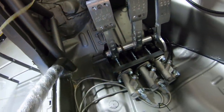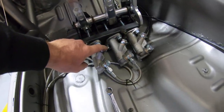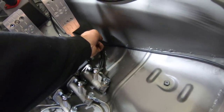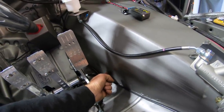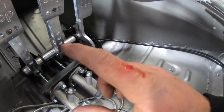Here's a view of the pedal box with the lines hooked up. I haven't hooked up the clutch line yet — I'm still deciding where I want it to go through the transmission tunnel. I want it to go through the side of the trans tunnel so on the other side it's a quick jog right to the bell housing. With a floor-mounted pedal set, I think that's the best way to do it. Just working here, trying to finish this up — and trying not to bleed on the car too bad.